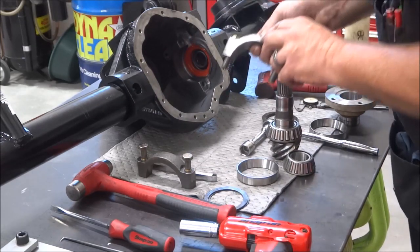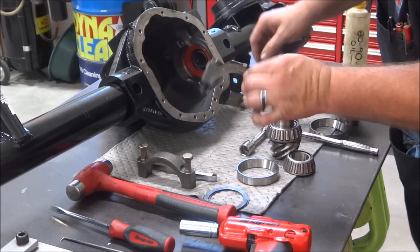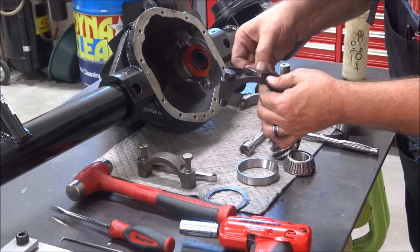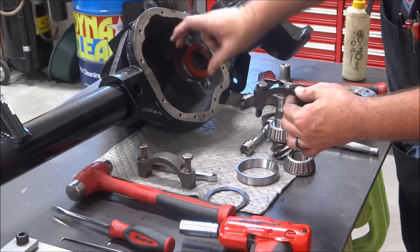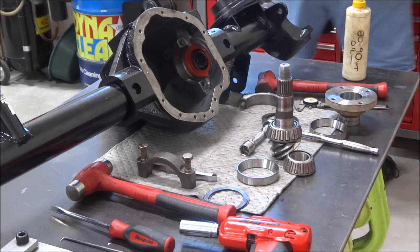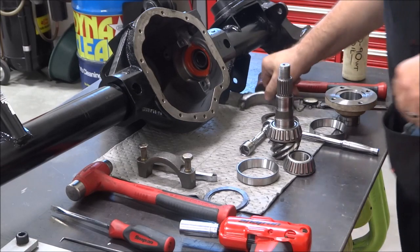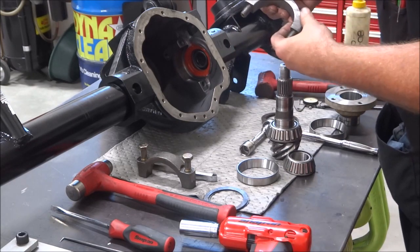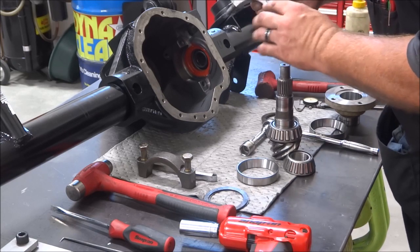The factory style uses a thinner cap, and it uses this stamped steel piece under the heads of the bolts that goes over and catches the coil and holds the coil in position on these e-lockers, on these electronically locked carriers. On the ProRocks, they've got a thicker cast cap, and they've got the little pin or the little tip here cast right into it.